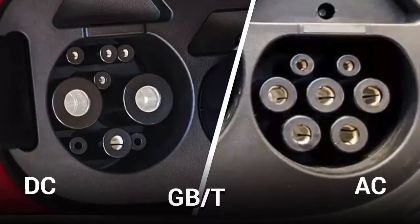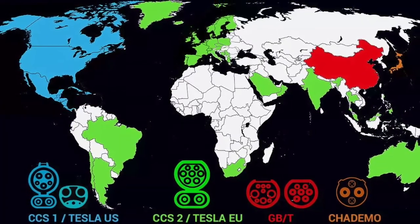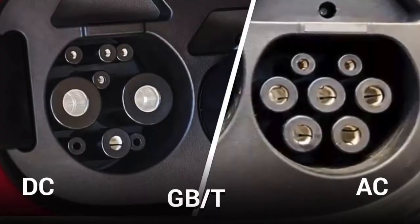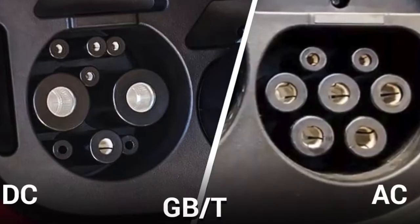I can imagine quite some people are now scrambling to find the links to purchase such a device, or to see what the caveat is. Unfortunately, the caveat is usually the charging port — these devices mainly support the GB/T port, which is not available in some countries. Here you can see a map of the countries where different charging standards are supported. The red part is probably not covered by most of the audience of this video. I'm really hoping they will also release a similar device for CCS1 and CCS2 ports so we can use these in the US and in Europe, but it appears the current standards are really holding this back.